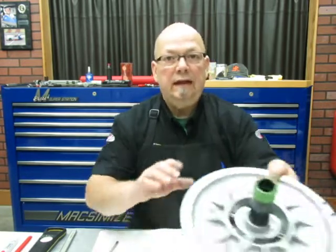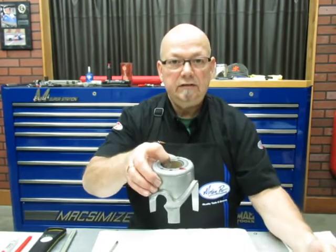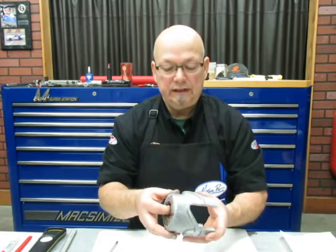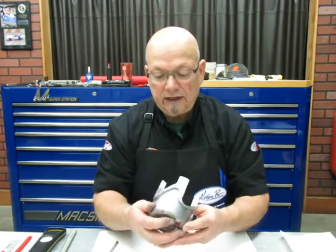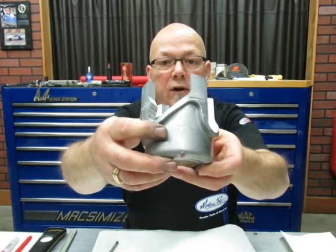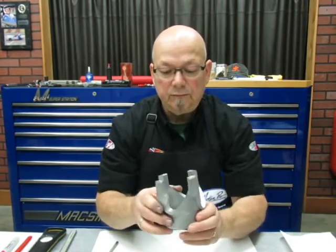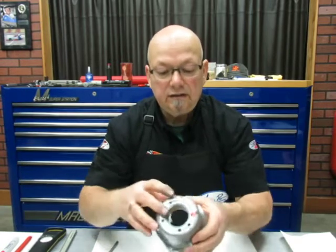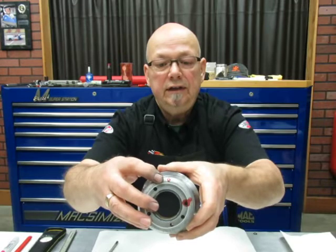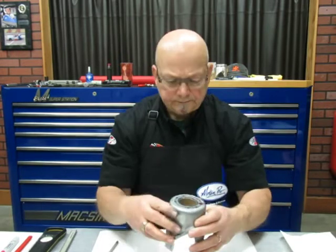But again, we did apply that tape on here to protect the bushing in the helix, so that's important to do on disassembly and assembly. Now, as I stated earlier, Skidoo does mark their helixes here, 4740. You'll find a number on all of them, okay? Now, something key on putting this helix back in, they say we've marked the arrow. They don't always line up perfectly, never will. And then I marked where the spring location was, okay?